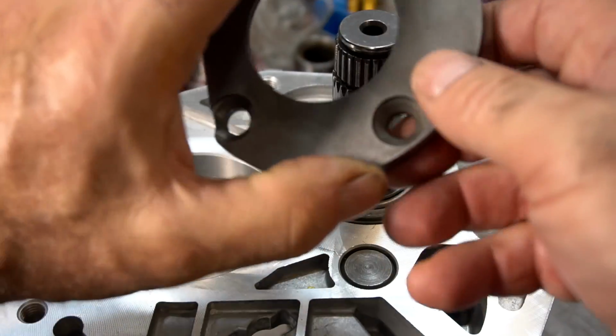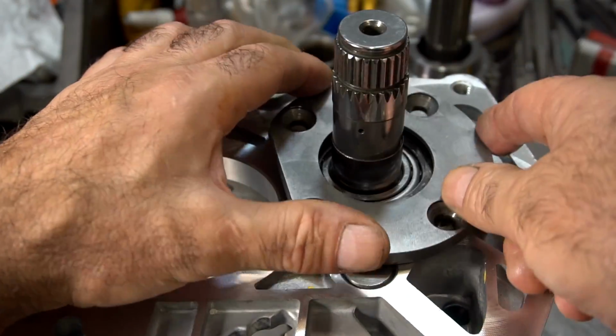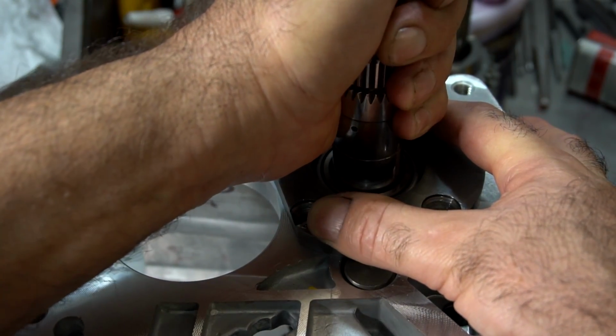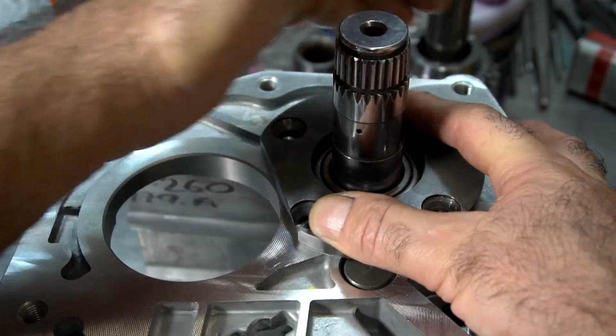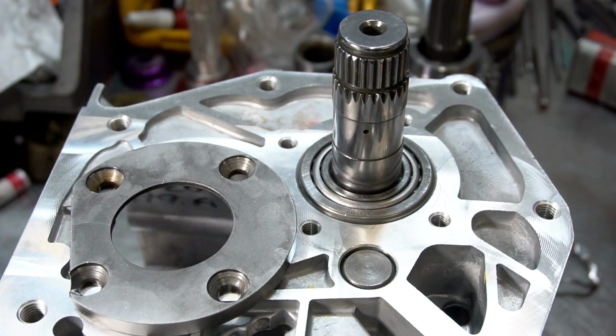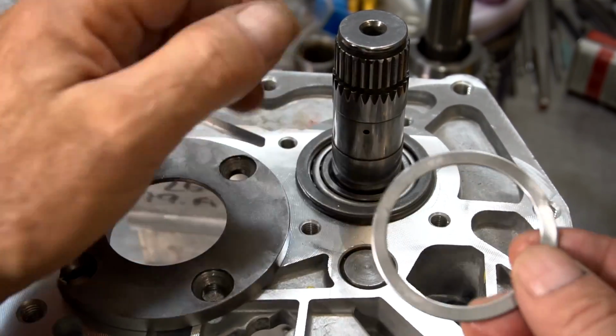Now, these are my stabilizer plates. We're going to start with the old shim that was on there. Put that on. We can just hold it down. We can see we have a lot of movement, okay? Too much movement. So, a lot of times these Gforce gears, the tolerances are very off in regards to the shimming. So, I have my peel in place shims, which are a single shim and a peelable shim.